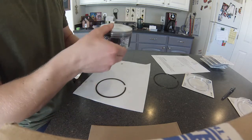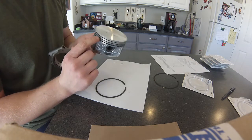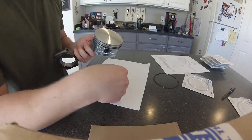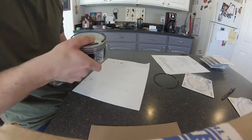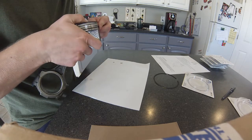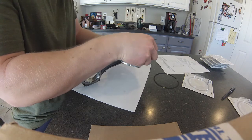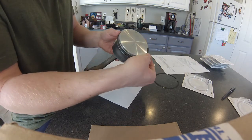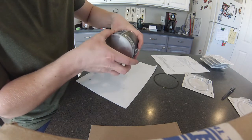That one is going to go towards this mark. Our oil ring is gapped right here, and this one's gap will be up there. These are a little bit harder to do just because they are much stiffer. You're just going to pull it around just like that.